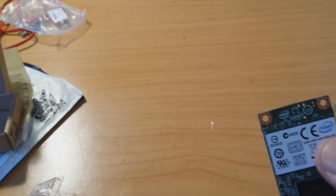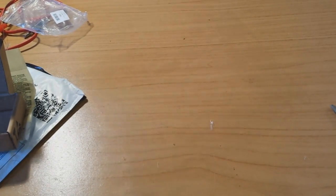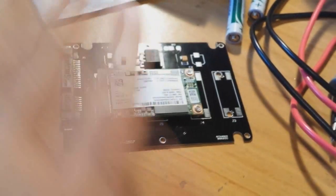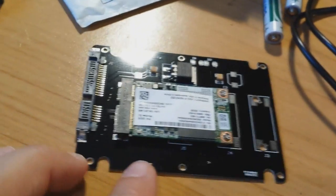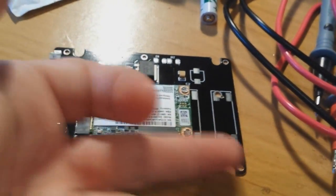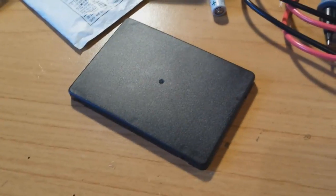Intel inside. It is supposed to be 50mm long, and yeah, it just fits like this. Now I have an SSD. This is how it looks mounted up, and you can get away without soldering these bushings — it has some springy action. As you may know from mSATA or mPCI Express, the spring force component holds it laterally so it doesn't move much in that direction. It will do the job without soldering. Black thing without label — I actually like it. Beautiful. I hope the connector or the voltage regulator doesn't crap out on me, but I have some confidence in it.